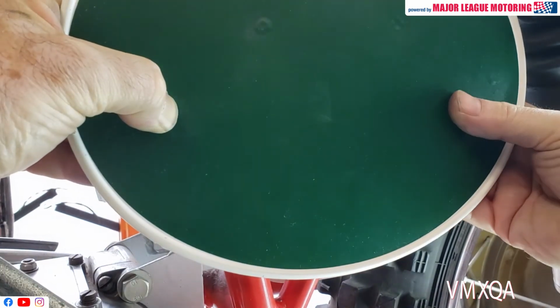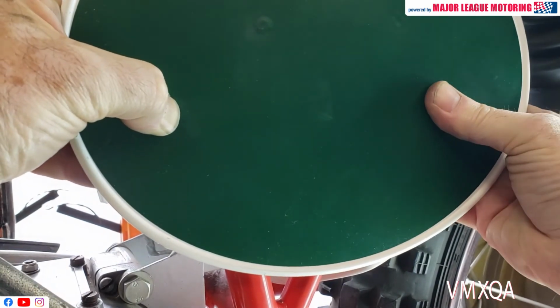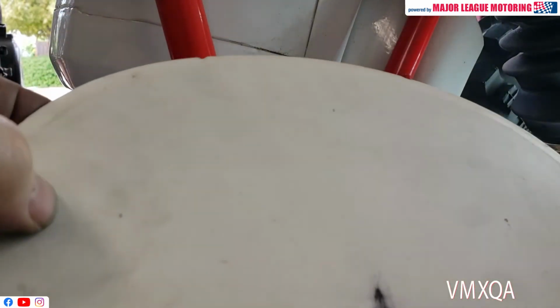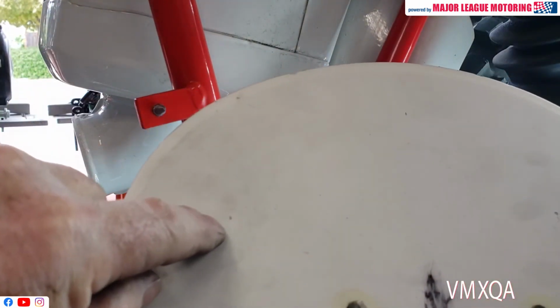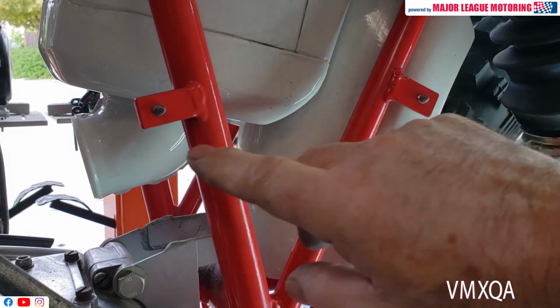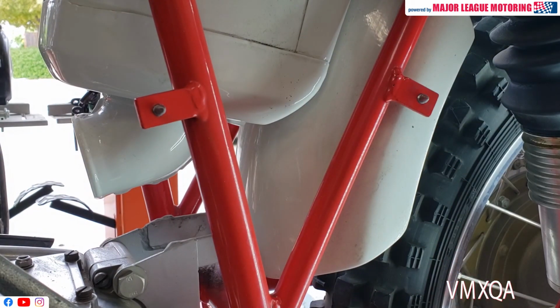With a good push on it, where the points are for your screws, when you turn that plate over, there's one right here, and there's one right here. You can now go drill your plate, and you're going to have confidence that the holes are going to be right where you need them.